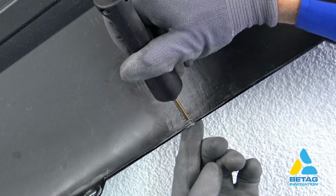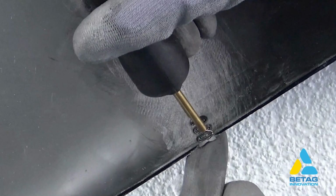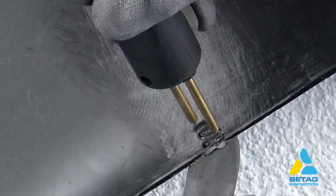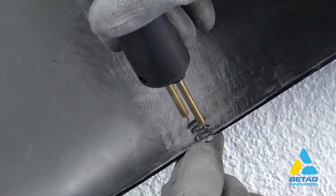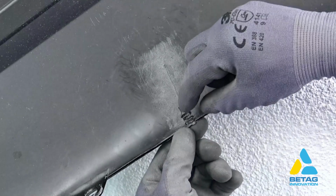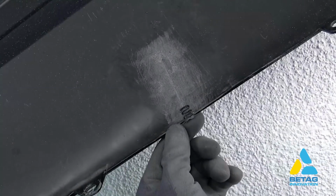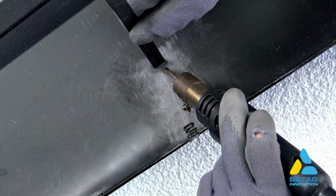Next, we place a tack at the end of the tear. This is just to stabilize the area for the welding. Once the staple is placed, give it a little twist before releasing the stapler. To remove the handles of the tack, simply twist off the ends. Here is an animation on how to position the staple in relation to the tear, and the twist at the end. The next step is to weld the tear using the plastic fusion.